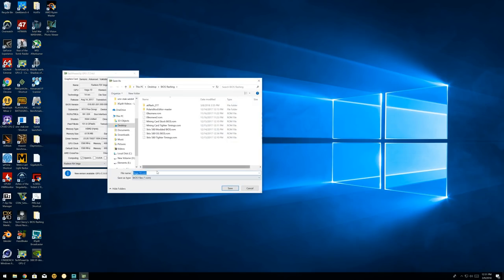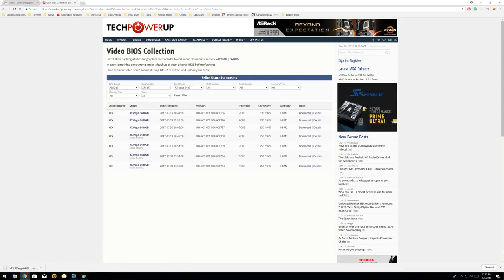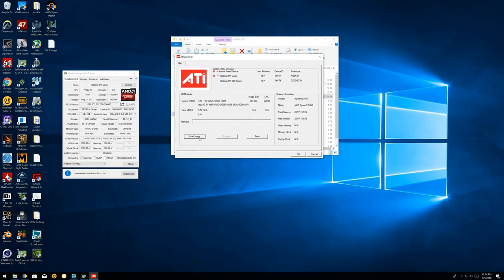The first thing we need to do is kick the original Vega 56 BIOS to the curb and swap it out with a fresh new Vega 64 BIOS to unlock higher overclocking settings, because we're all about voiding warranties like that. And crashed again. Maybe we'll try a different BIOS and crash. What about this BIOS? Crash. What the flippin' fudge? Eventually, we did successfully flash a Vega 64 BIOS onto the card, but when used as the primary GPU, we couldn't get it to boot into Windows, something we never really had an issue with when working with the reference card.